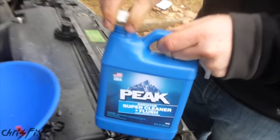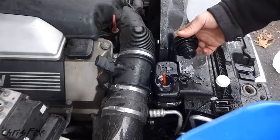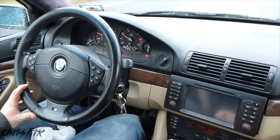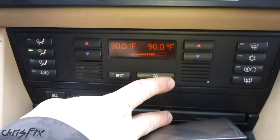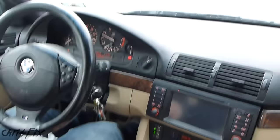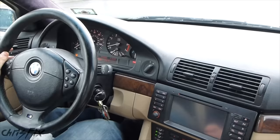Now we're going to add our chemical flush — add the whole thing. Let's go for a ride. The car is running great and maintaining operating temperature. We're going to drive around for at least 10 minutes so the water and chemical flush clean out the cooling system. Pay attention to the temperature and make sure you don't have a problem with air in the system that could cause your engine to overheat. Make sure you're blasting your heat all the way — if you don't feel the heat, then you have air in your heater core and might not have added enough water. We've been driving around for about 15 minutes and the temperature has been stable, so we're going to head back and flush out all the water, then add our antifreeze and go for another ride.